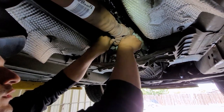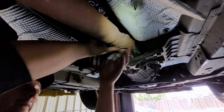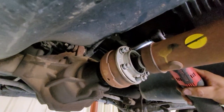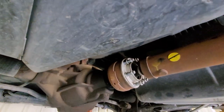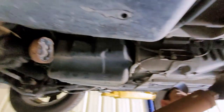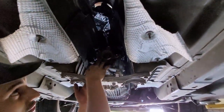Using a 12-point 12mm socket with a 3/8-inch drive, remove the yoke bolts, let the yoke sit, and go ahead and loosen up the driveshaft. Collapse the driveshaft inward, choose a drop point, and remove it. Now you have complete access to the shifter. This vehicle has a non-factory shifter, so it's a slightly different process — remove the two 13mm bolts to take the shifter body out from underneath. The shifter assembly can stay with the transmission as it helps hold it since it's solid mounted.